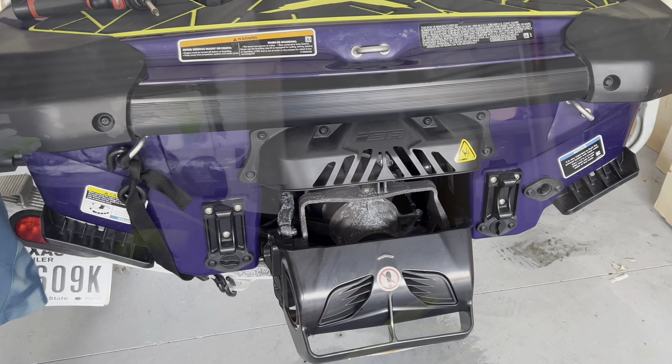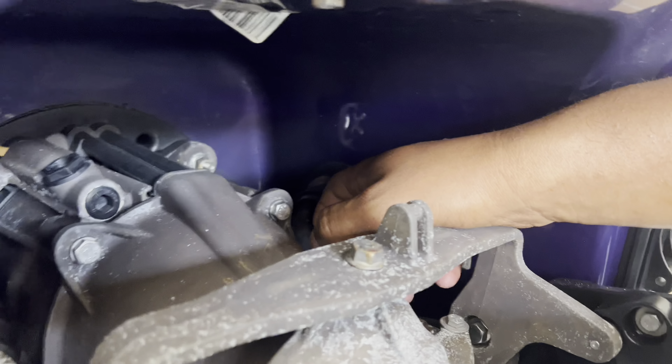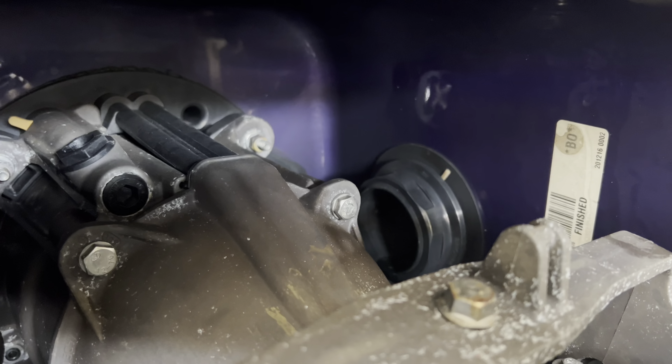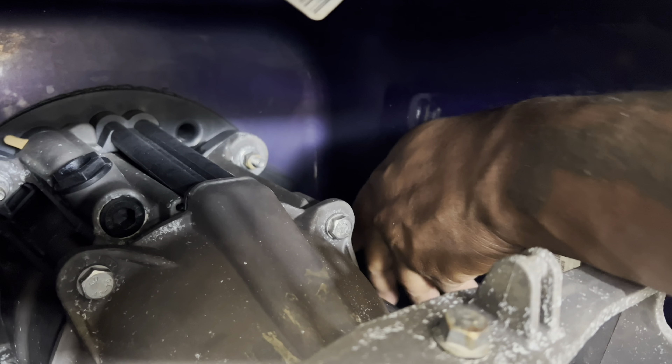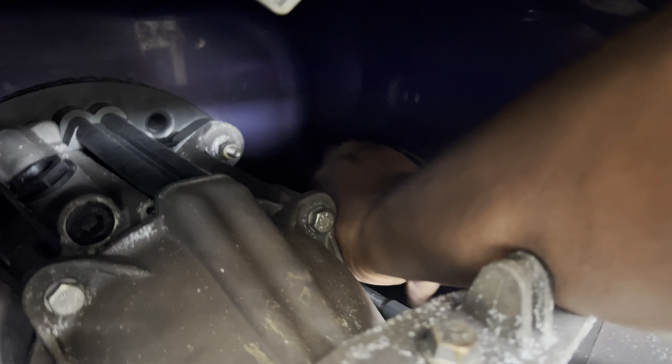Remember to take off your IBR guard — go through and hit all six bolts, take that off, and then you can reach your hand in better to get to the nut. With your IBR guard gone and your IBR all the way down, you should be able to reach back to your OEM nut, twist it back towards the front — that's the off direction. If you got a kung fu grip and been hitting the weights you'll be able to get it off.